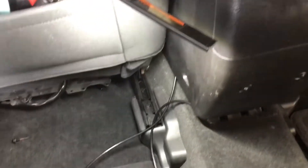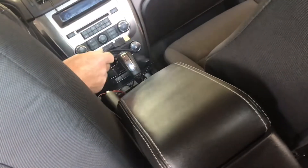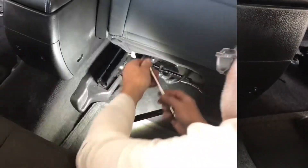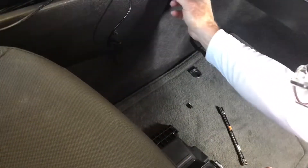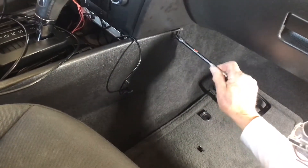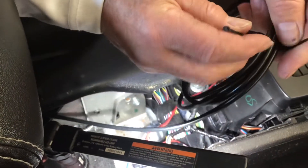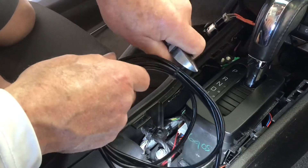The remainder of the electrical cable can go to the front of the console area. You can lose the excess cable under the console or the cup holder area. A 15 foot cable will work but to be on the safe side I bought a 20 footer just in case I ran into a problem. Make sure you test the cable before closing everything out by connecting it to the camera. In my case the large USB connector goes to the front where the power point connection is and the small USB end connects to the camera. There are six screws that attach the console to the vehicle: two at the back, two at the front, and two underneath the cup holder. The extra wire can be looped and zip tied — make sure when you put it in the console area it doesn't interfere with anything. Pay attention to the parking brake mechanism, but there's plenty of room in there so it shouldn't be a problem.